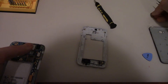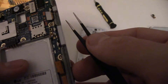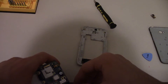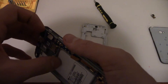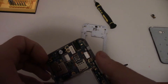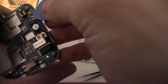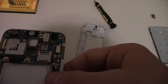Facing up — I don't think it really matters that much because this is a junker and I can always fix the camera by buying a new one for cheap. I'm going to take that off and then make sure everything's disconnected here. Pry up with your guitar pick — just pry up somehow or another. You may not want to use that other thing because it's going to damage it. Make sure not to destroy it. You have to bend parts to get parts up. Sometimes it can be hard because it's sort of glued on since there are no screws right here. All the screws were taken out.